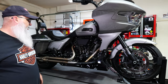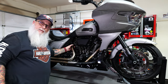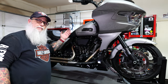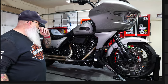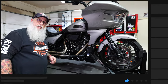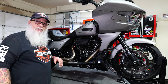Very easy to install — didn't have any issues. The only tricky thing is when you're dealing with this breather valve: disconnect it back here from the top of the block to get some line, but don't pull it all the way through because fishing it back underneath would probably mean lifting the seat or the tank, which we don't want. Just lift it up, move it around, aim it the same direction, and everything goes in really nicely. Let me know your thoughts — like, subscribe, leave comments. Hope you liked it — see you on the next one, be good humans!